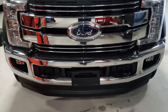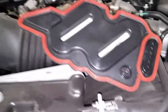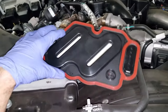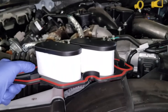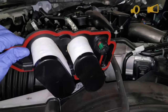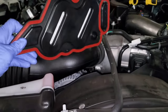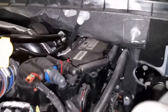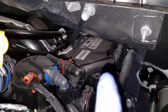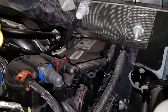What's going on guys, welcome back. I have a 2017 F550 tow truck and I am going to install the new crankcase ventilation filter. There's just an updated spring right here that comes with the filter, so we're just gonna pop that in. It's in the same spot as the other breather case, but as you guys can see there are bolts going all the way around, so we're gonna take that lid off and try to finagle the filter out.